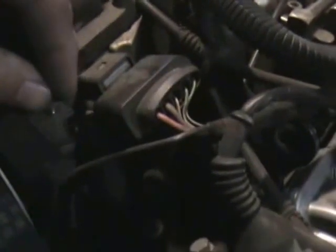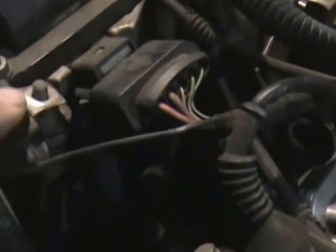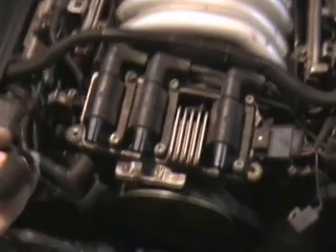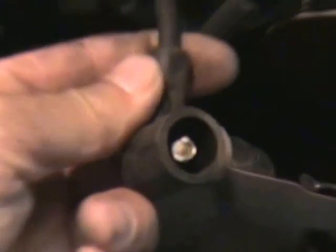On this coil pack there are three coils across here, set up like this. This comes off and there's another bolt to undo right there. Before you work on any of these coils you always want to disconnect the negative battery lead. We got all the bolts off and all the plugs out. You've got to be really careful when you pull these plugs — pull them straight out, otherwise you're going to break the tips off and get little remnants. I might have to get new spark plug wires. Those are fragile.